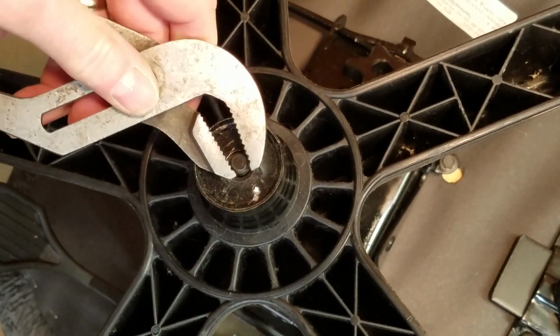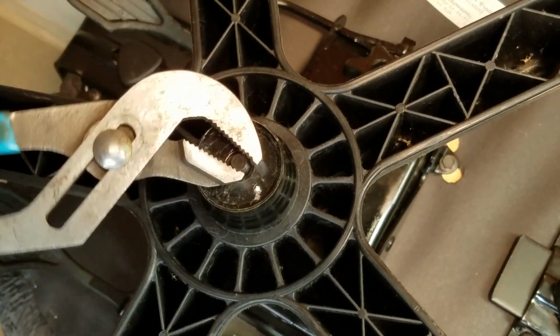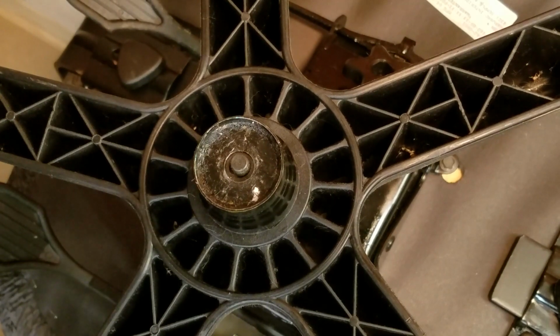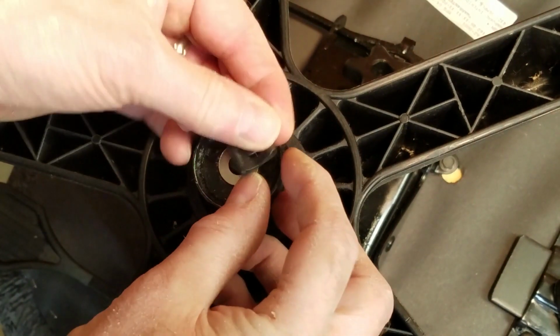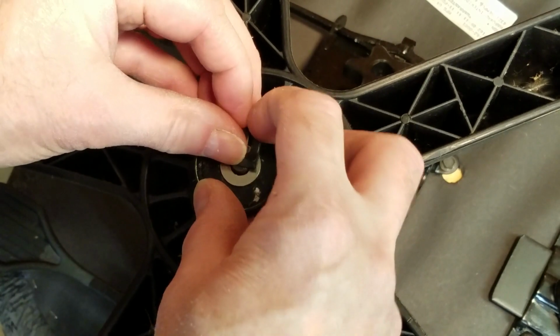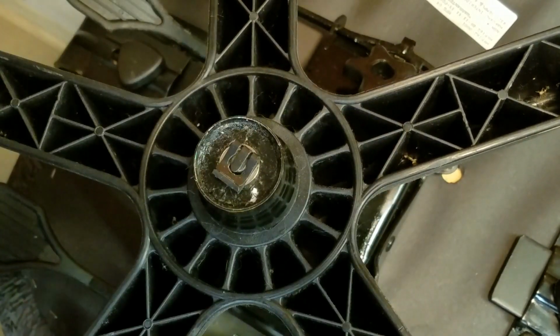Whatever you do, don't grab onto the support rod where it goes through the seal. That could damage the finish of the shaft and cause the cylinder to fail. Replace the clip if needed, extend the cylinder, and flip the chair right side up. Hopefully these easy fixes should get your chair working again.